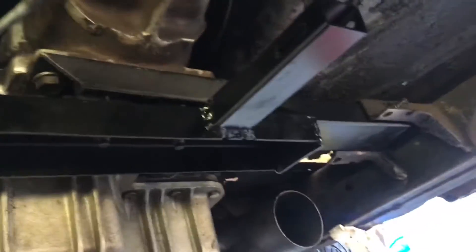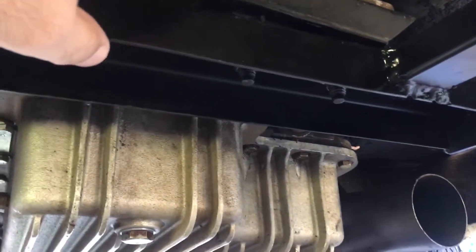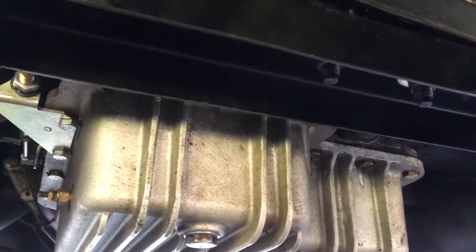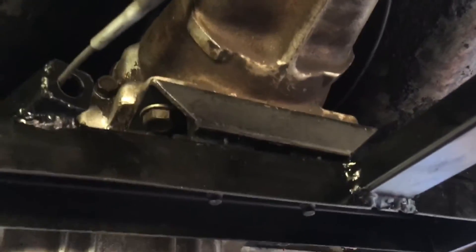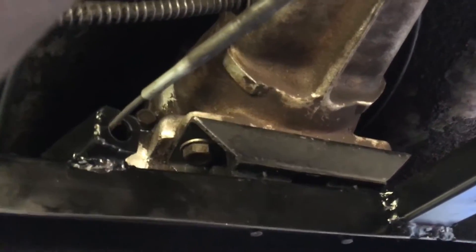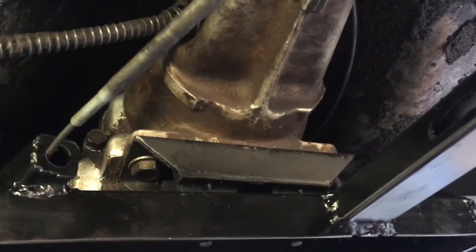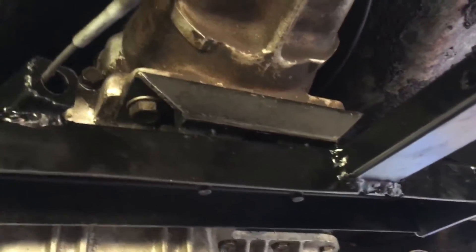Highly recommend it. It did come with the correct transmission isolator — the rear tranny mount. It's an Anchor product, I want to say Anchor 2253. If you need a replacement, they've made millions of these in the secondary market and you can get them from about $15 and up. It comes with it, so it's pretty much a simple bolt-in using a modern part as opposed to the old-school mount that wrapped around the old cross member.